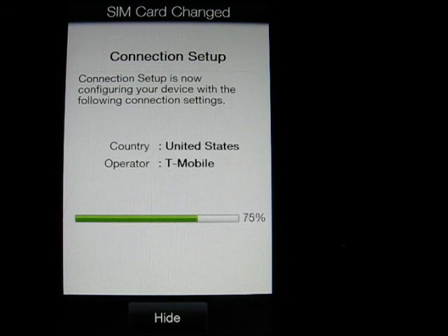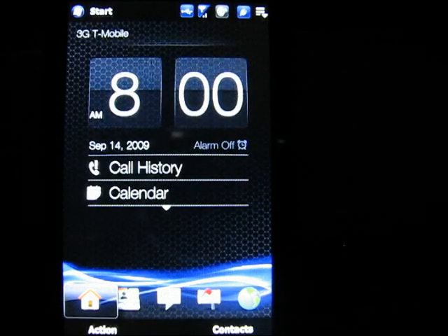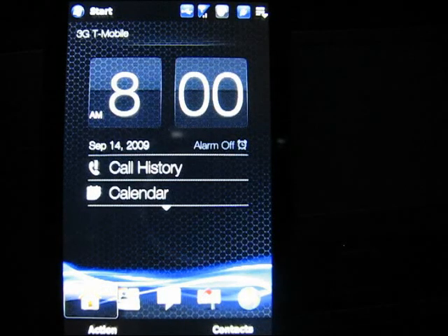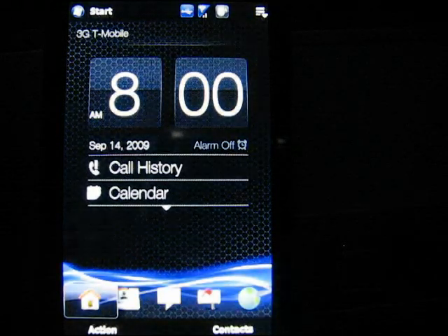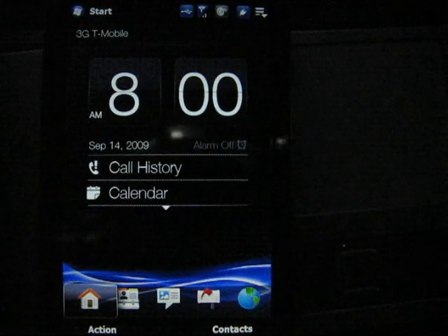There are some people that say take out your SIM card and take out your micro SD card when you're doing a ROM change or upgrade or update — I consider it a change. I don't do that. The main reason they have you do it is to prevent any problems, but also if you're expecting somebody to call you, there's a danger that when they call they may screw up the update process. They recommend that you take out your SIM card so no calls can come through, but I don't bother — and plus it's late at night.